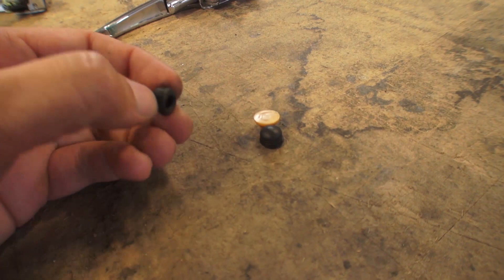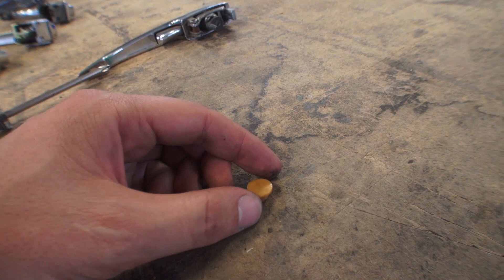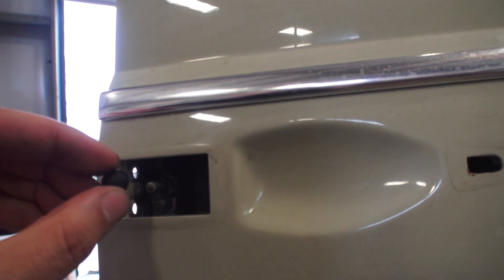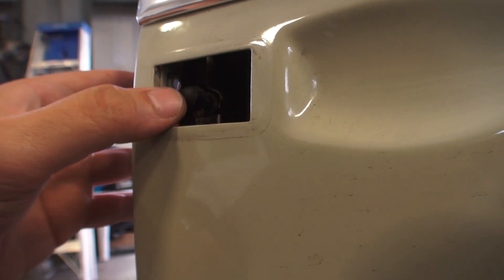Come over here — see these little rubber hats. You get these on your wheel cylinders; if you buy brand new wheel cylinders they have these on the bleeders. Sometimes you can use a rubber grommet, but a rubber grommet doesn't have a sealed end on it. See if you can rummage around and find something like this. All you need is just a little extra to push that shaft. I found these fit nice and snug on the push button shaft. That just gives it a little extra length.